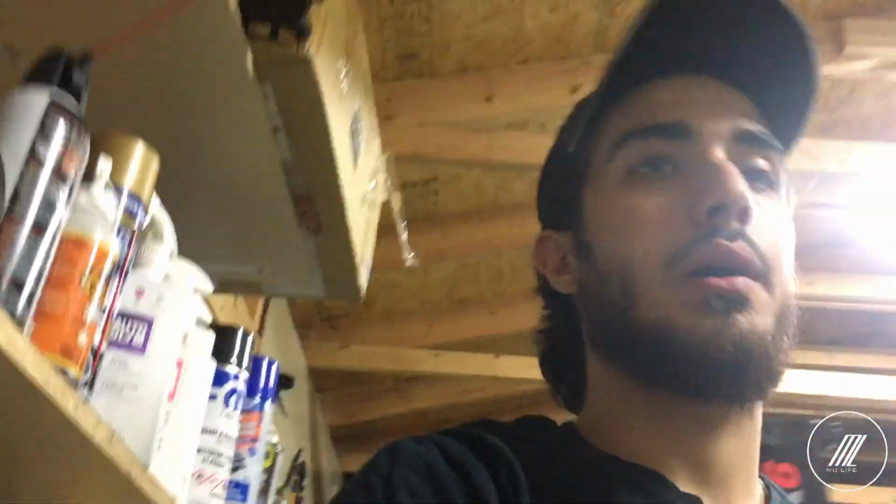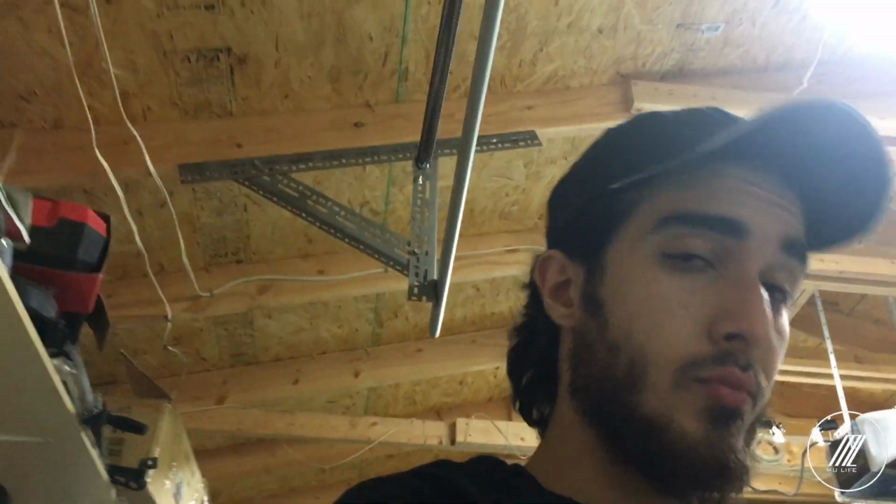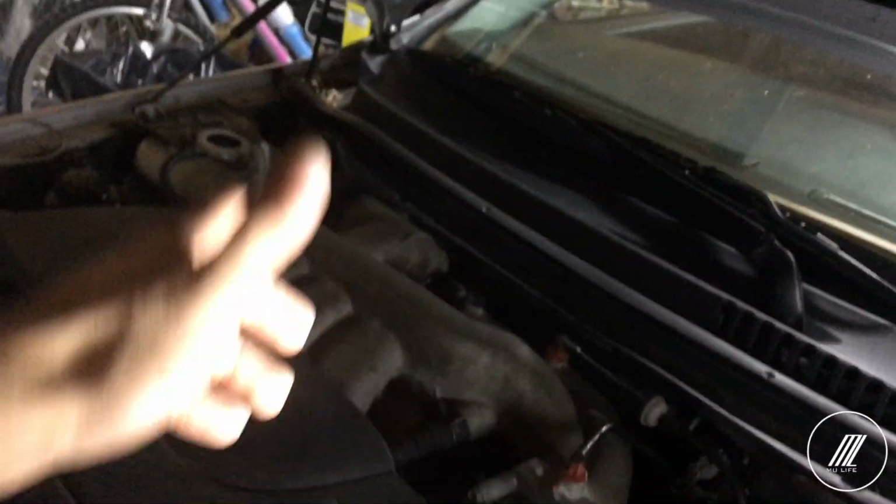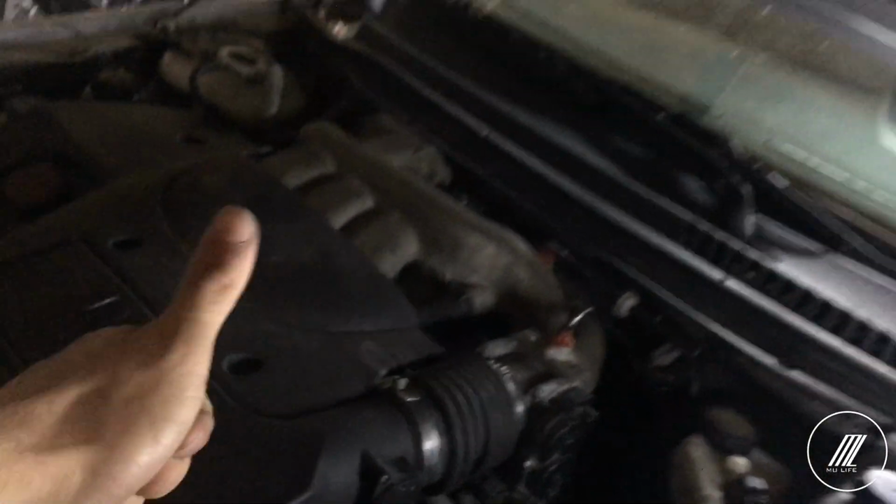And I figured it out by spraying some brake cleaner around the engine, and when I heard it hesitate, I knew that, okay, there's a leak in that area, and I recreated the gasket for it. I'm still getting that code, but I'm not having any misfires, so what I'm gonna do is take off the top and bottom, because I never did the bottom. I didn't even know there was a bottom until I did a little bit more research. So today I'm gonna take off the top intake, redo that seal, redo that gasket, and do the bottom one as well, and hopefully that fixes the problem.